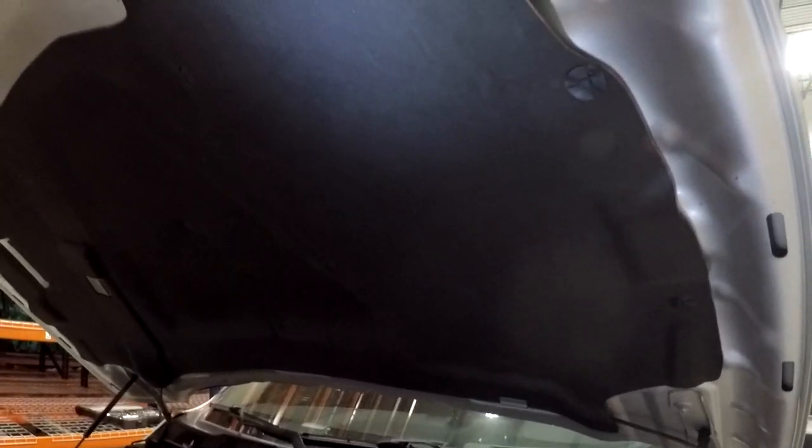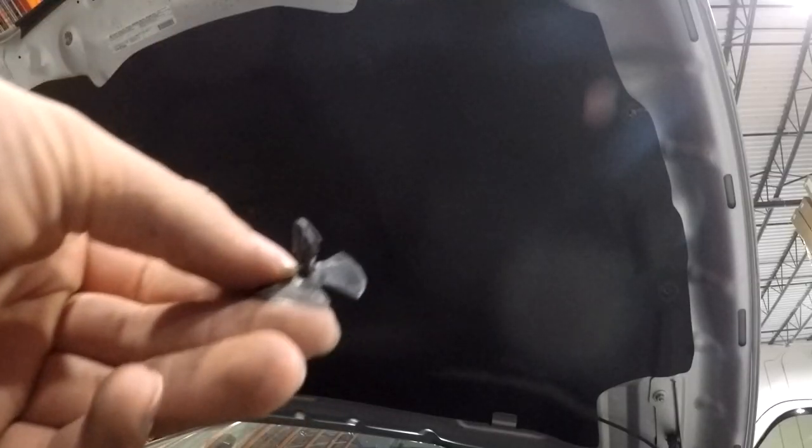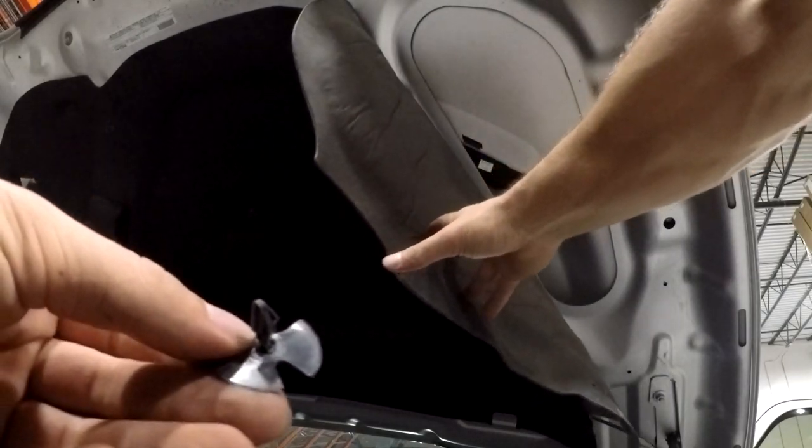This one's out. On the driver's side you're going to see that there's not really a quick release tucking in to hold this liner — this underhood liner. You're going to see push clips that have kind of a little star cloverleaf type look to them. We're going to have to pry those out to get at the driver's side hood vent, so let's go ahead and pop these out.